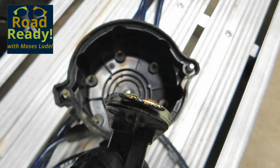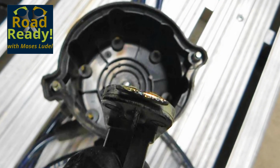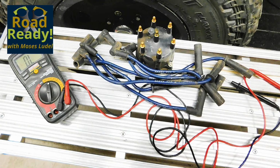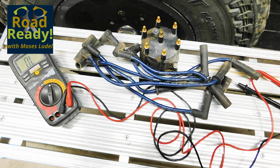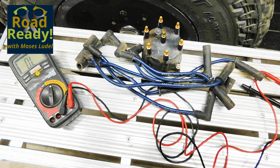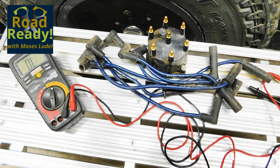The longevity of these ignition parts is a testimonial to electronic ignition distributors. In the breaker point era, these parts would never have functioned properly at this kind of wear level or mileage. A high energy ignition and coil can fire despite this wear.